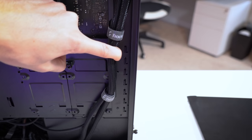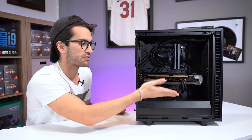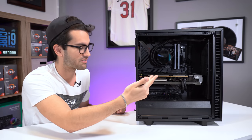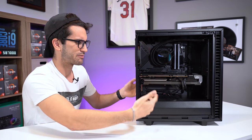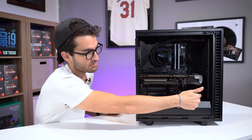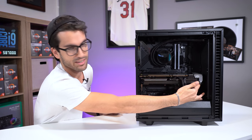As a result, you've either got to just deal with the sag, which doesn't look that great. You can turn the graphics card vertical, which will compromise additional PCI slots — you can't use expansion cards, capture cards, or Wi-Fi cards — unless you have multi-riser vertical kits, which exist but aren't very practical. Or you can use a cheap little standoff, maybe a 3D printed one or something similar, that will hold the far side of the graphics card up and get rid of that sag.